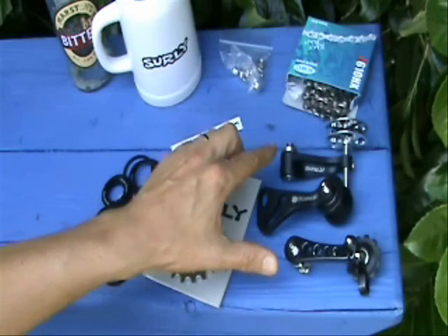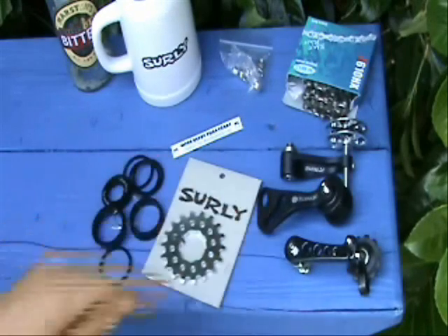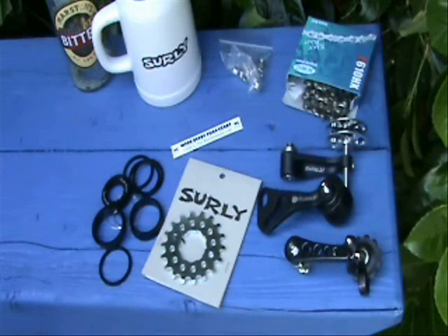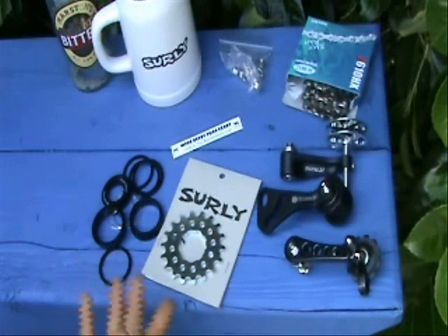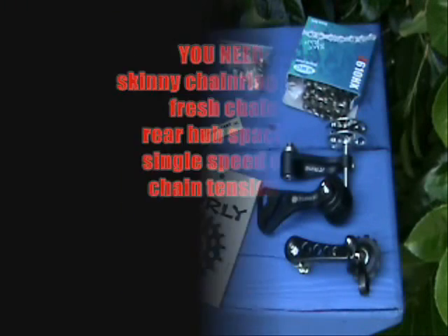The Gusset uses a roller — it's great if you're a bike killer. The other two use a jockey wheel, which is quieter, and these are ideal for road bikes and cross bikes. If you kill bikes, get the roller one. Around here we have a single speed cog — they come at different price points and materials. Steel ones last longer than alloy ones; the Surly ones are the best of the lot, even drilled out to look cool. And then we've got a bunch of spacers that go in the back where your gears used to be.